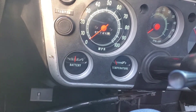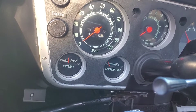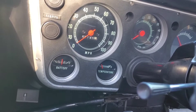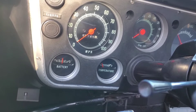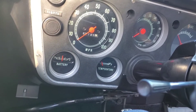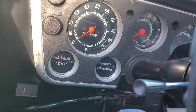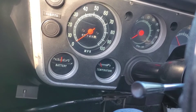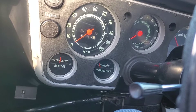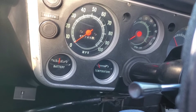There are three things controlling whether the torque converter clutch locks or not. First, there's a speed sensor that I got from Dakota Digital — it's for their cruise control systems and it sends out a five volt square wave signal. The second thing is there's a vacuum sensor in the box here that's sensing ported vacuum from the carburetor. When the throttle is closed there's no vacuum, and if you press the throttle open slightly you get high vacuum, and it tapers off the harder you press the throttle.